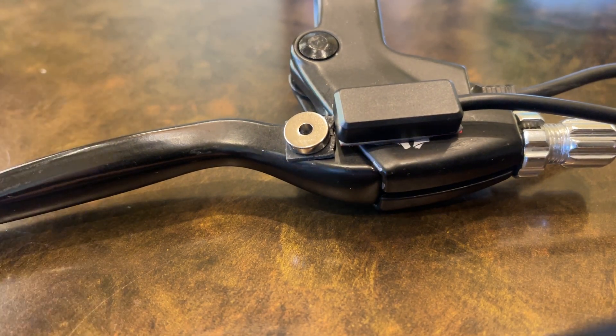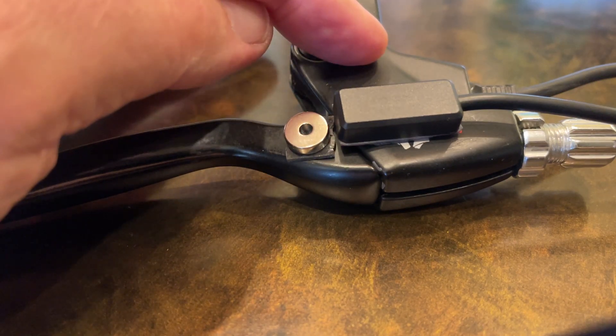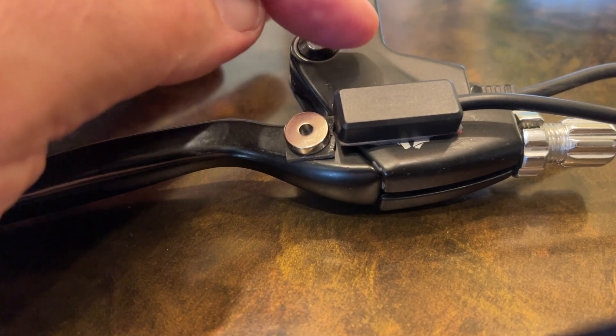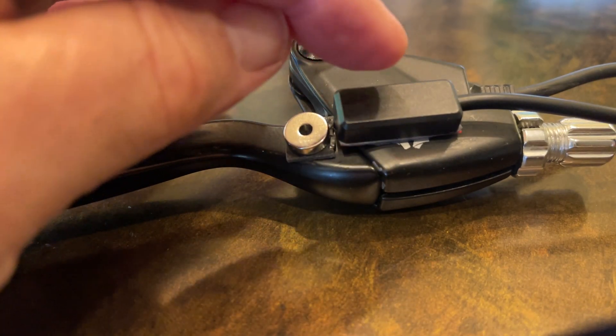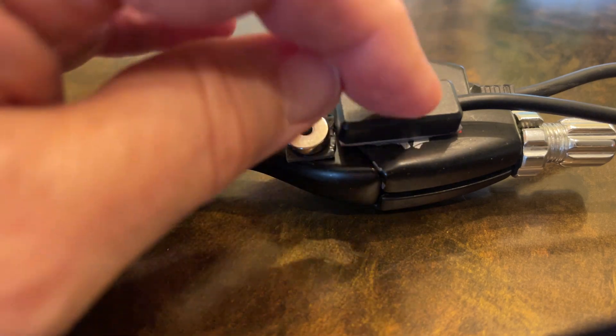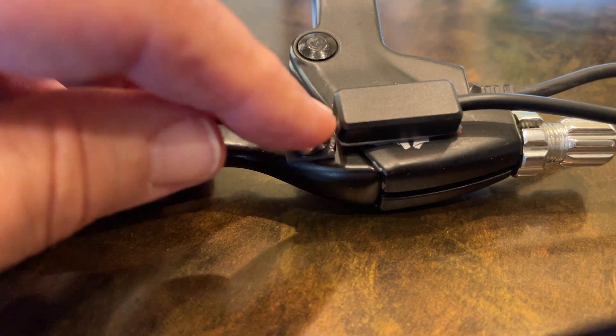You can't really use those wires without upsetting the motor cutoff circuitry, which you don't want to do. But the other way to do it is there are optional switches used on some bikes where people want cutoff switches that do not have the switches built into the brake handle. That is to fit a magnetic switch onto the brake handle using some super strong 3M double stick tape and putting a little trigger magnet onto the brake handle.